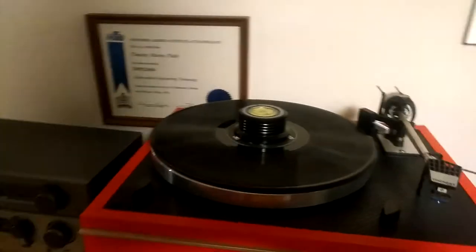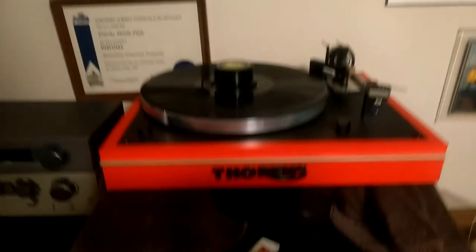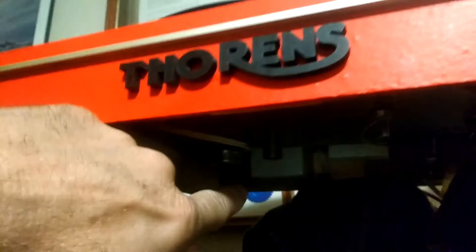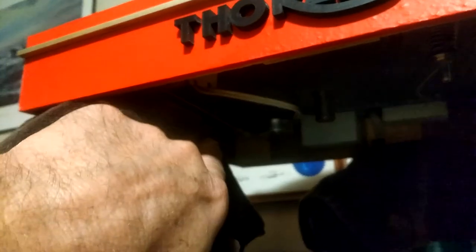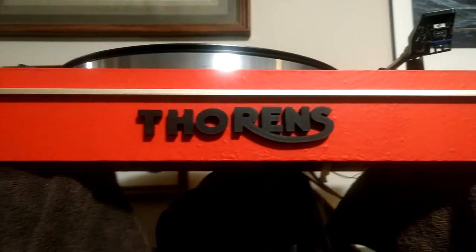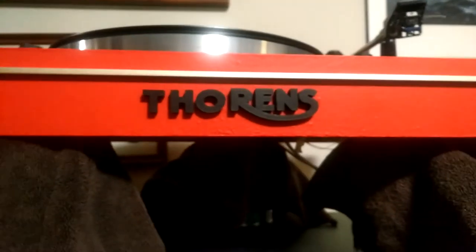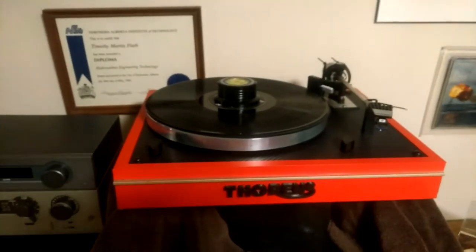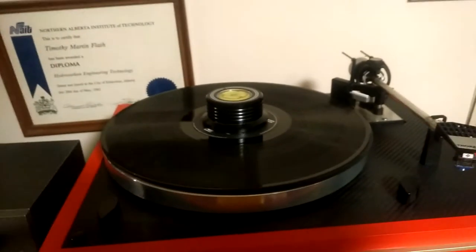You've got a spring over here, a spring in the back corner, and a spring on this side. In order to properly tune these you have to get them up in the air, take the bottom off, and as you can see, there's one spring right here, spring back in there, and then a spring back you can just barely see around this cloth padding. Ultimately, you want the platter and the suspension tuned so the platter is tied to the tonearm by those three springs, which isolates it from the actual plinth or base of the turntable.